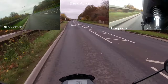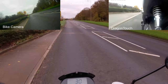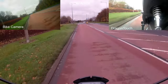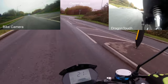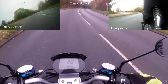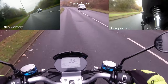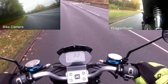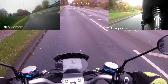The big test for these bikes is hills, and that's usually where electric outperforms petrol — electric scooters have a lot more torque. The only downfall of an electric vehicle is range and power capacity. Even up that small hill, where a 50cc scooter would probably just maintain a steady speed, the electric one has no problem climbing. Going downhill we're free-wheeling using no power at all, coasting up to 33 mph. As it flattens off, the amp usage goes back up.